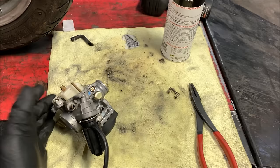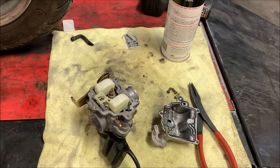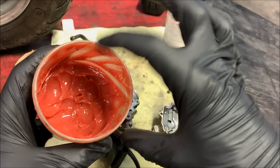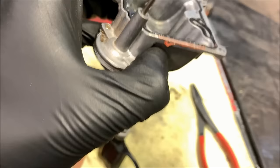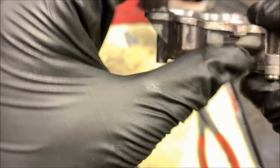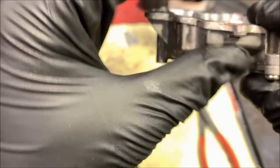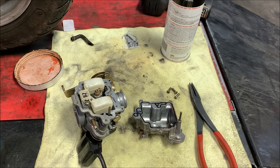Once you have all that set, get your float bowl. The gasket is popping out a little bit, so get a little bit of multipurpose grease — I like to use Red Line grease — just a tiny bit in the groove. This will help that rubber edge seal and help it stay down in its groove. Make sure they're not overhanging; if there's extra slack, when you tighten it down it'll be pinched instead of sitting in its groove, and you'll put your bike all the way back together and have a fuel leak, which is never nice.